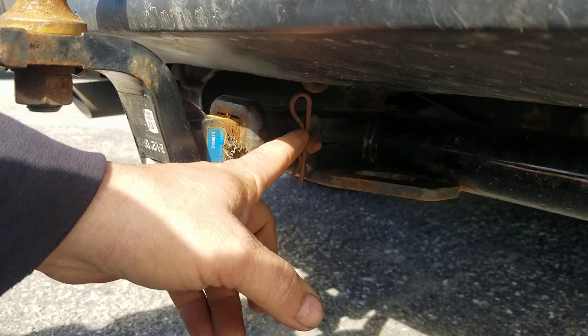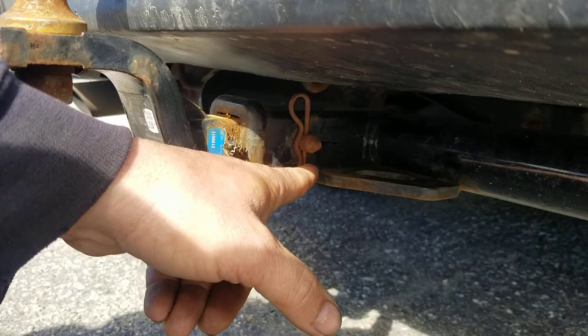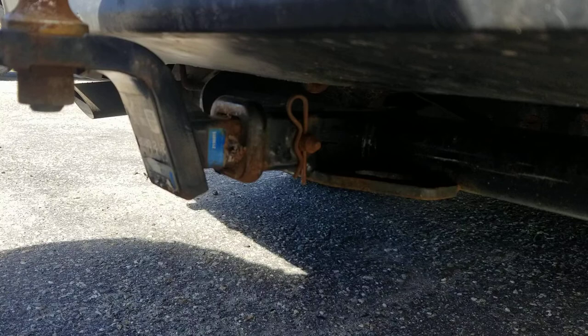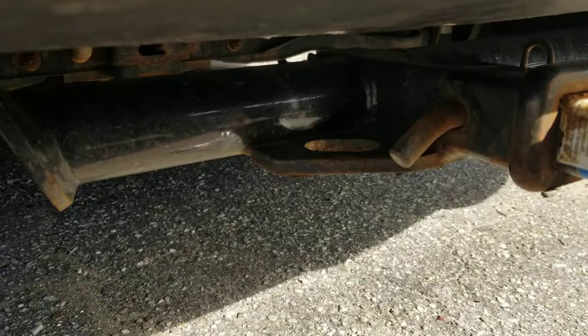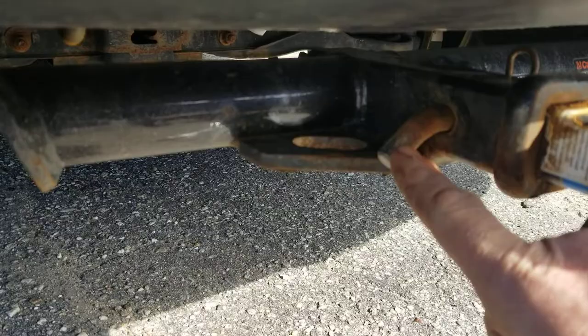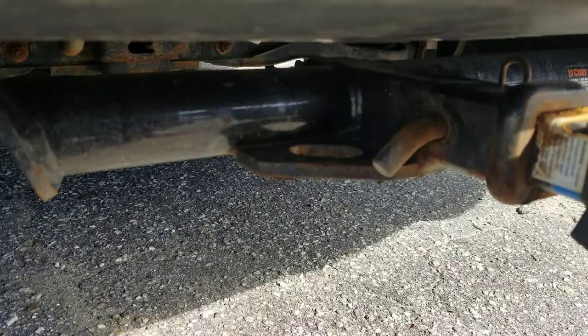In the relaxed position, not in the pin, it should be touching. After it's installed in the pin it still should be touching — this pin should always be touching with no gap at the lower part. The proper way is to install the hitch pin going from the top down, with the weight or lock part facing down, because it can't come out that way. It binds itself right in — that's why it's got the bend, but it's also a weight, and a lot of people don't know that.